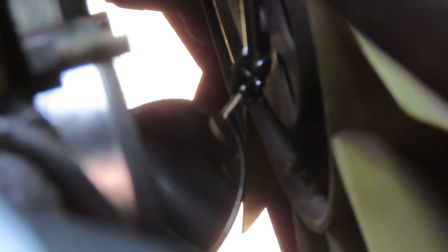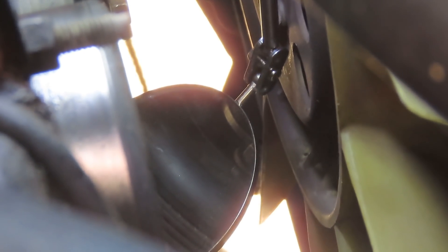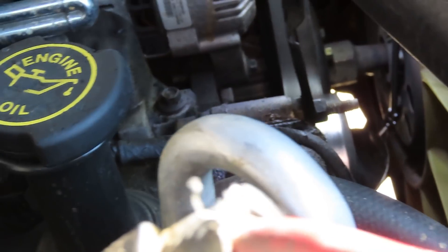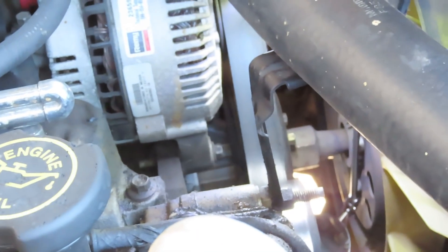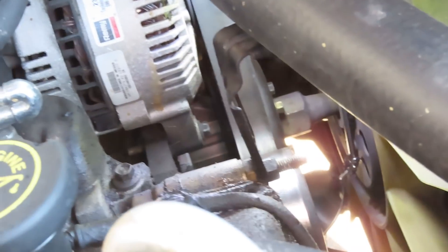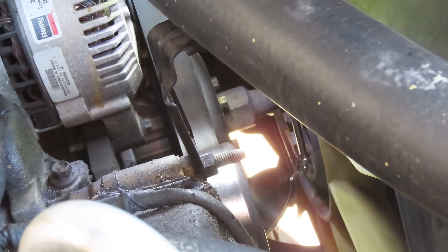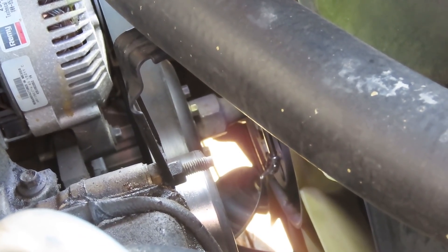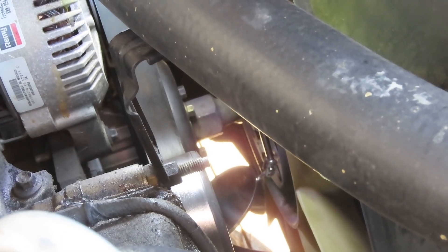The customer said — you're going to find this weird, it's going to be funny. The windows were fogging up in the mornings and he couldn't get the defrosters to work because the windows kept fogging out. He saw a leak coming from the vehicle, but it wasn't from up here. So the mechanic said your water pump, and the guy changed the water pump. Come to find out it was the heater core. I don't know if somebody changed the heater core or not. But then, two months later, now it's leaking. It looks like maybe he tightened the gasket to the water pump too tight. Or just the water pump is leaking — could be a cheap water pump. I have no idea.